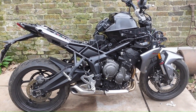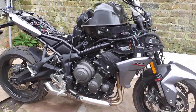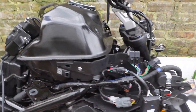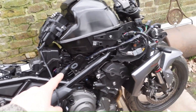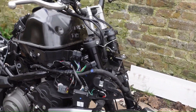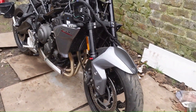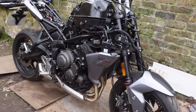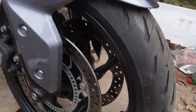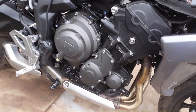Things went south very quickly. I started to strip the bike down to access the electronics and one thing led to another - these wires caused me no end of problems. I was trying to figure out why the bike wouldn't fire up. I was swapping parts with the Triumph Trident 660 - changing out the clocks, the ECU, the immobilizer, all of the gadgets. It turns out in the end I just had to plug in the correct clocks. I bought a set for £250 on eBay, put those on, and the bike fired right up.